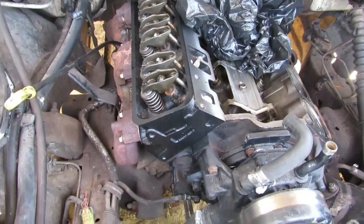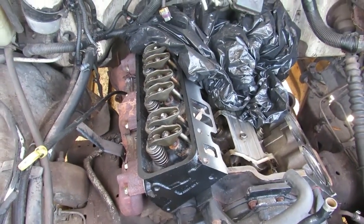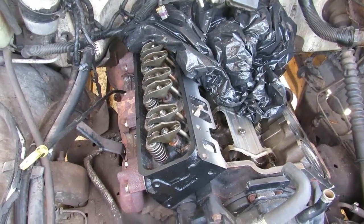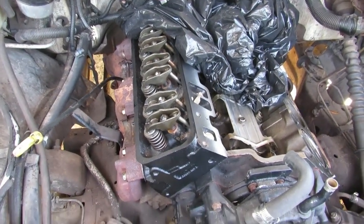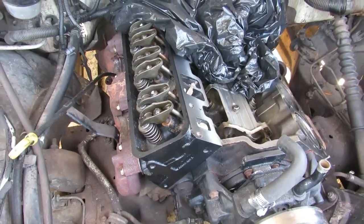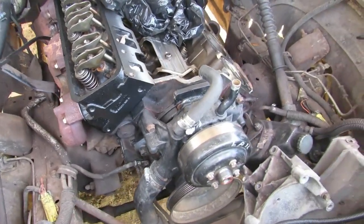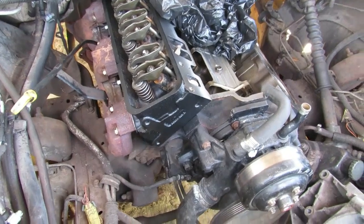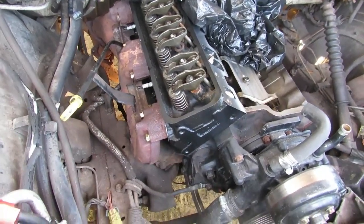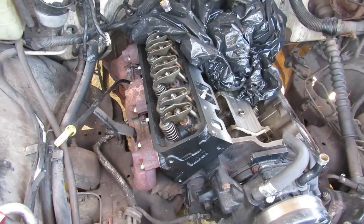The story on the heads: this head here is brand new. The other head had cracked from the exhaust manifold guide all the way to the bolt - it about cracked the head in half. I had to buy a brand new head. These 5.0 heads are really starting to get hard to find; everybody's doing the 5.7s. These 5.0s don't get much love, but they're good little engines - the low-end torque is really good, which is why they put them in these four-wheel drive Cheyennes.